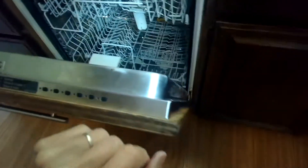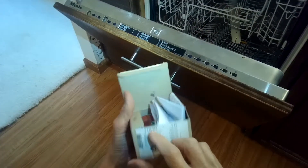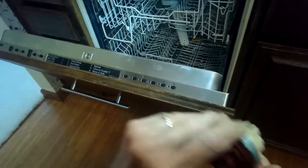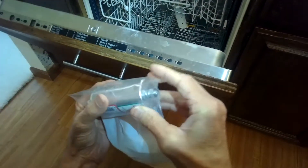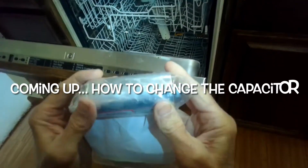Eventually it'll show an intake/drain error flashing, and if you do the code check it shows F08, which says the heater pressure switch may be having trouble — that's part number 5419692. But this is probably not the culprit. It's just a switch that tells the computer if there's enough water pressure. The pump is probably not creating enough pressure because the run capacitor that helps it run is worn out.